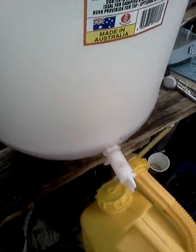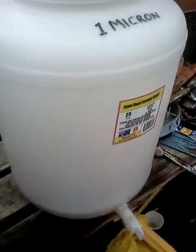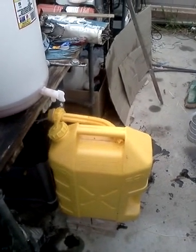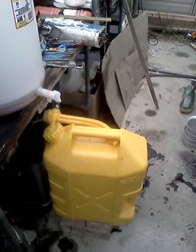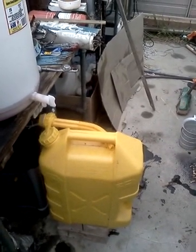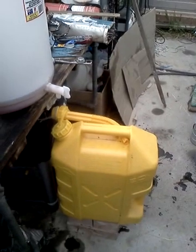I place the jerry can directly underneath the tap and turn it on. I go down to the service station and fill it with 10 litres of diesel — it's a 20-litre container — then fill it almost to the brim with 1-micron filtered oil, giving me a 50/50 mix I use through summer. I can wean that down to a 20/80 mix during winter. I've also just purchased from VEcar, the German site, inline heaters and attachments — the whole kit for under $250 Australian. It pre-heats the filter on my car and a water-heated device between filter and pump heats my oil up to temperature quite nicely.